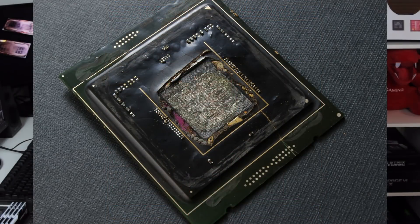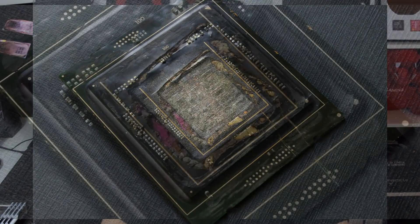Here's a close-up of the package. The bottom PCB still looks quite okay, but the top PCB is pretty much damaged — you can see it has a darker color. You can still see all the residues from the underfill that surrounds the die, the stuff I removed with the knife. Zooming in, we can see all those small bumps that connect the die to the package.